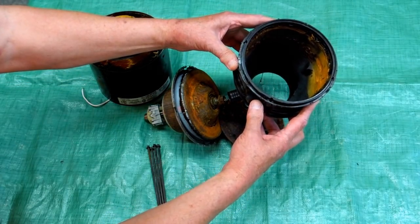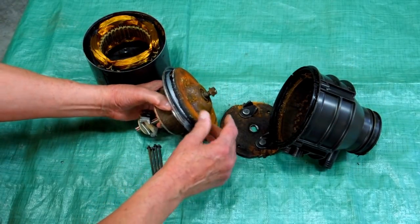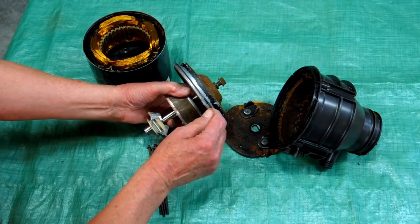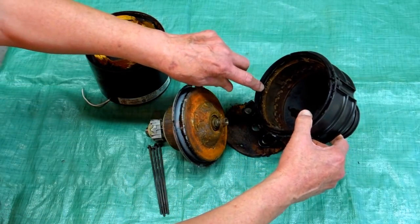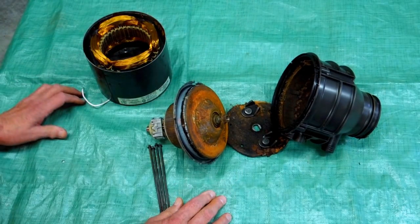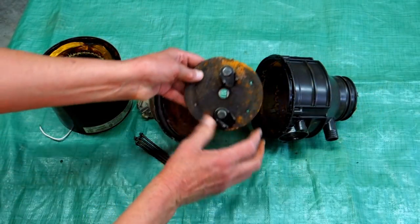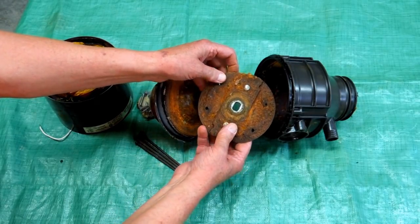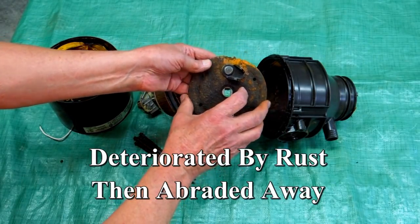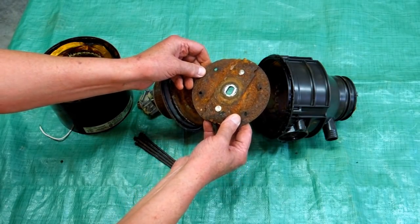This housing is plastic. This bottom part is shoved up in here with some sort of a mastic — it's very sticky, they glue that in there. And then there's an O-ring that seals between this unit and the edge right up in here. That seals pretty well until the unit fails, and then water goes everywhere. This thing started making noise like an air raid siren a couple of months ago, and I looked inside and could see bits and pieces of this metal had disappeared. That's probably where the noise was coming from. It quieted down again after a while, and then last weekend it failed altogether.